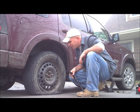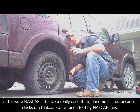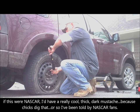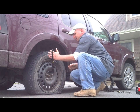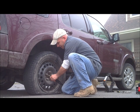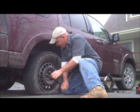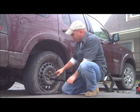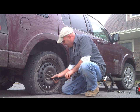This isn't NASCAR and this isn't about speed — we're not running a race. We just want to get back on the road as safely and as reasonably as possible. So let's loosen the lug nuts first. We're not going to take them all the way off, just a bit. It's a good habit to work in what we call a spider or web configuration — moving across the bolts. Do this one, do the one across, do this one, do the one across. That pattern will help ease the tension of the nuts.